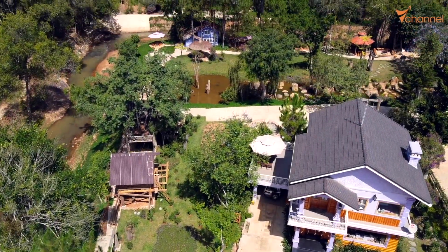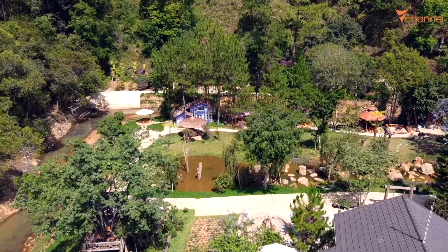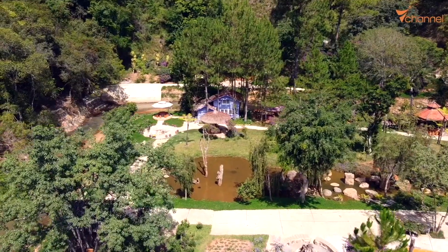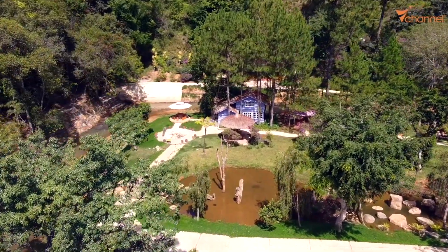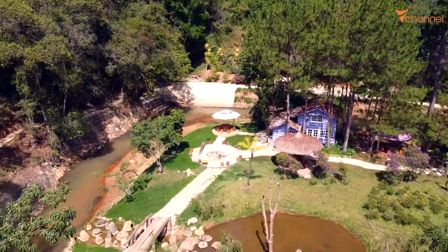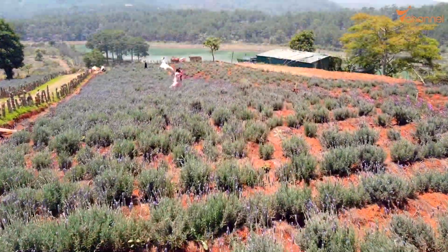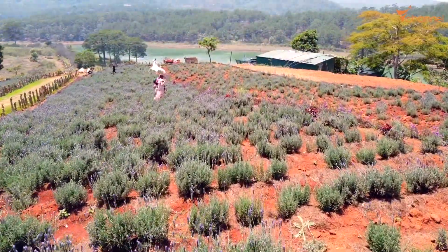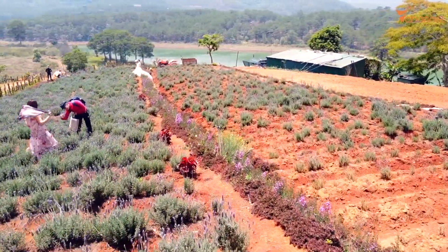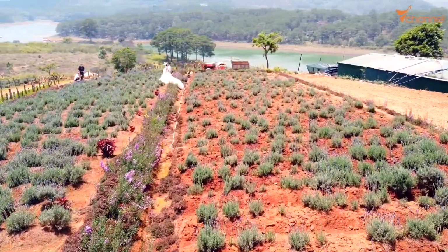Another upgrade of Air 2S is that we upgrade to OcuSync 3.0 or O3. Similar to the recent DJI product, the DJI FPV. It will help our aircraft have low latency, as low as possible. That is from 28 millisecond to 40 millisecond. So the reaction of the aircraft will be faster, more flexible. Because it belongs to OcuSync 3.0, the range will upgrade up to a maximum of 20 km. But that is in theory.